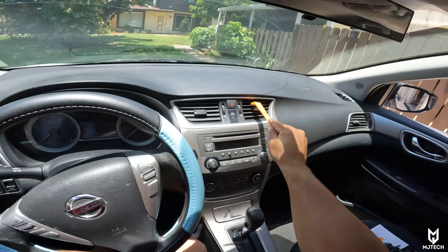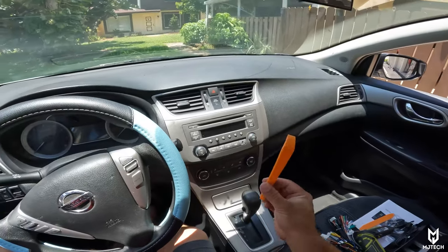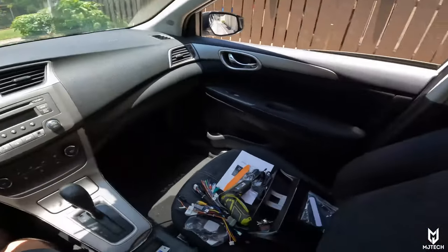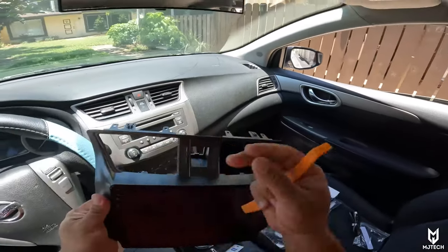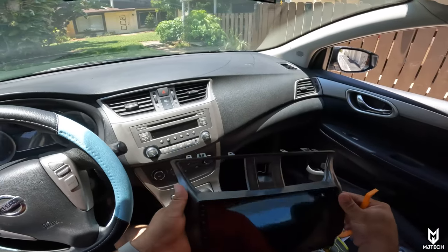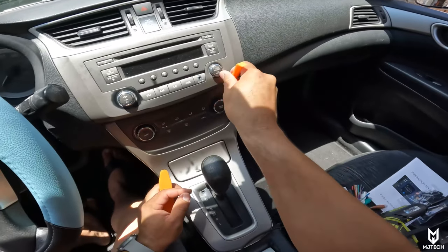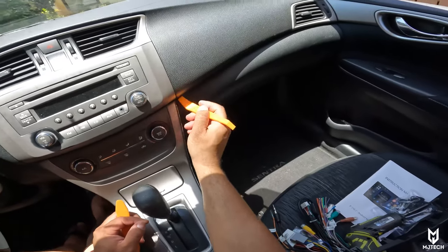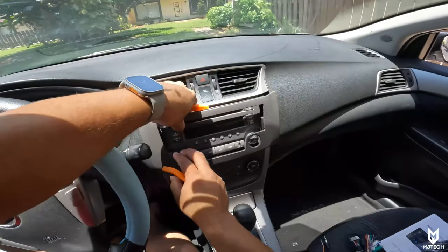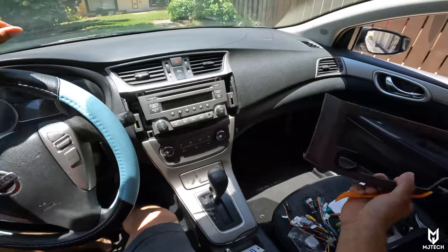We have to transfer the vents and the middle buttons, so hopefully it fits. I see a little bit of a difference between the airbag button and the hazard button — there might be a slight difference, but let's move along. The pry opening tools came included, which is nice. You go underneath and start prying it. Then the first section pops right out — very cool. Yes, we do have four Phillips screws and you might need an extension because they are quite deep.